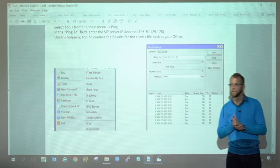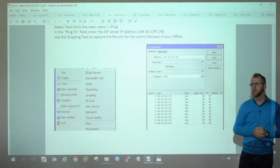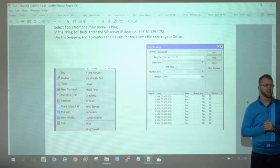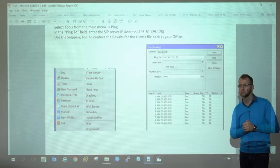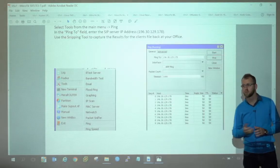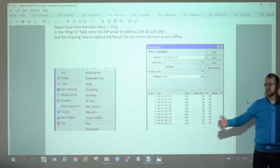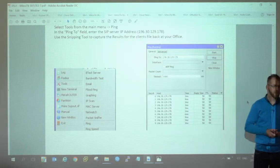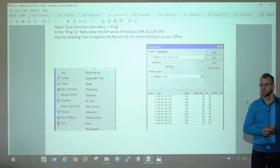Okay. What is better, the outdoor unit, the outdoor antenna, or an indoor unit with an antenna? Look, with the outdoor unit, of course, it's outdoors, it's line of sight, hopefully, so there's no signal obstruction in its way. With the indoor unit and external aerials, we have done some research and some testing on the aerials that we use. So the indoor and the outdoor unit, especially the Billion router with the outdoor aerials, nearly go hand in hand now. Okay. The longer your cable between the aerial and the router is, the more signal loss you're going to have. So we have a standard of 5 meters that we use, and our signal loss is very minimal then. So the indoor Billion with the outdoor aerials is just as good as a MikroTik outdoor unit.